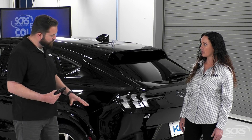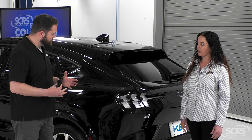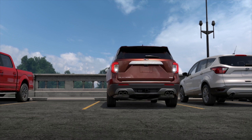On this particular vehicle it's going to be a dynamic calibration, so the vehicle is going to have to be driven through that dynamic calibration process. The major thing we're looking for is that there are objects for the radar modules to detect while you're driving — so if you're out in the middle of a big open field, it's not really going to work. I would also make sure that the driving conditions are safe; we don't want to go out in a storm. We want safe driving conditions while performing the calibration.